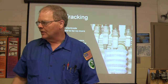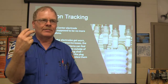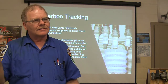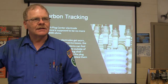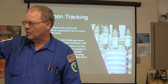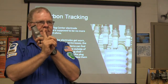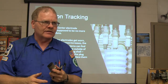Got it? Also, you see this chalked up spark plug tower, or looking up in a boot, you'll see it's either dirty and rusty or all sooty up in there. That's because that ozone, O3, is trapped in there every time a spark happens and it's trying to oxidize everything. But if you put the dielectric grease in there when you snap the spark plug together, it fills in all the cavities and won't let the spark carry through anywhere except where the metal's touching. If you don't put the dielectric grease in there, it can have little sparks, and that causes radio frequency interference and all that.